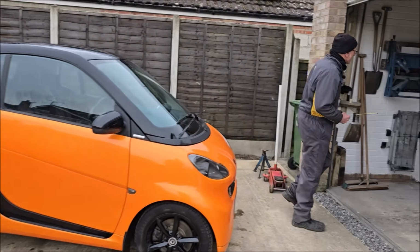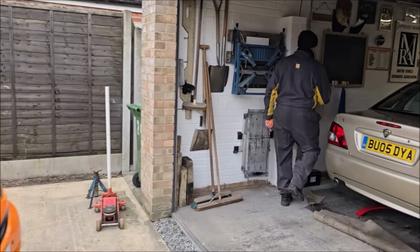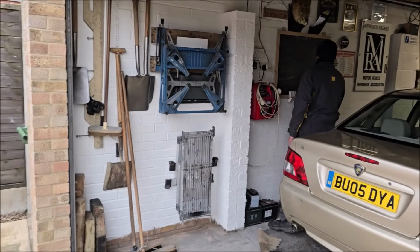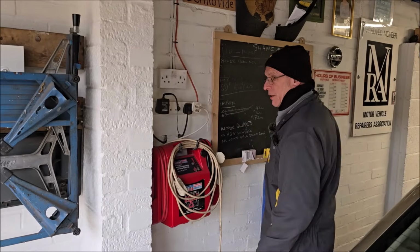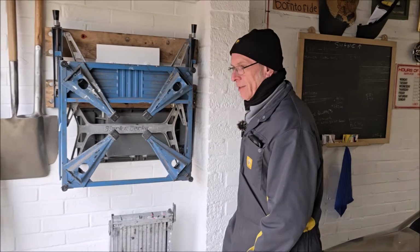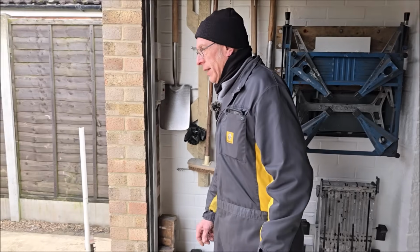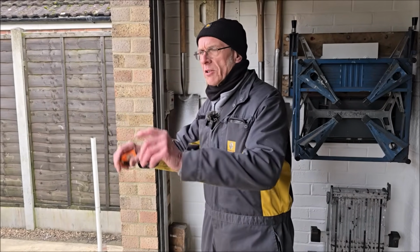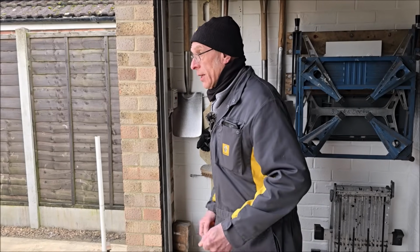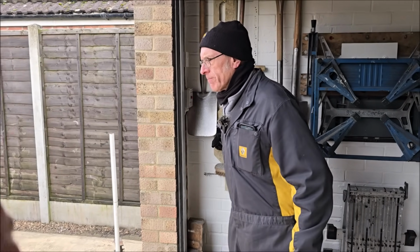Just talk us through the job, because when we did the 450, we were a bit blind leading the blind. We had to take all the front off, we had to take everything off. Yeah, how are we going to do this job? Because Kane has sent us some special tools. Special tools, we'll see how we get on, eh? Yeah, what do those special tools do? You can stick it through the spring and it clamps the suspension rod, and then you put a big spanner on it, hopefully. And it stops it from turning round.